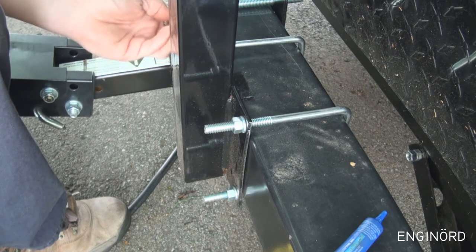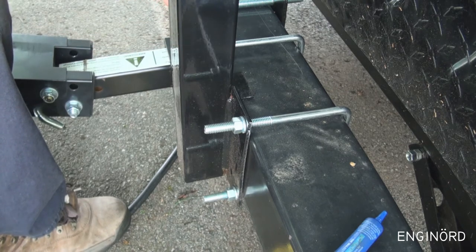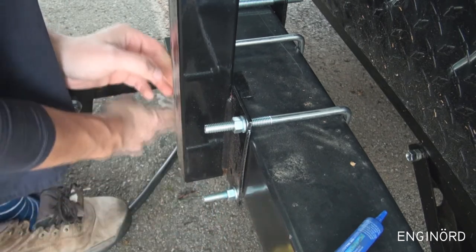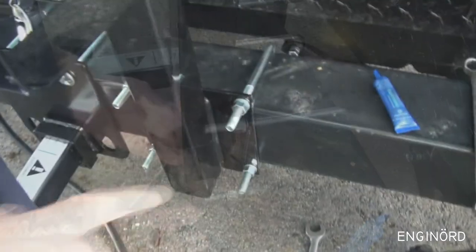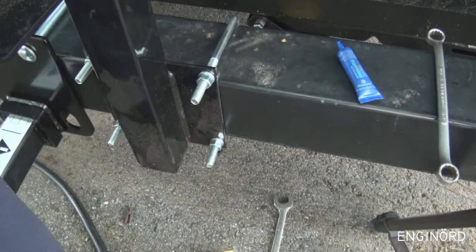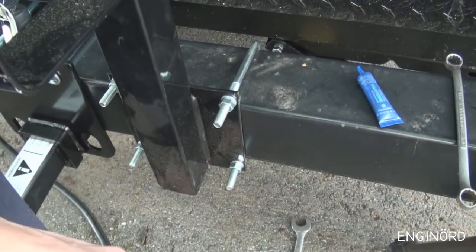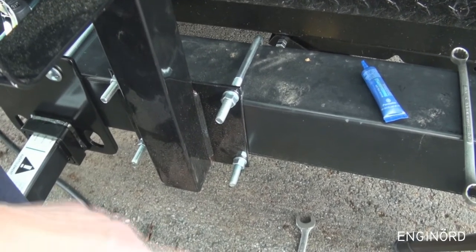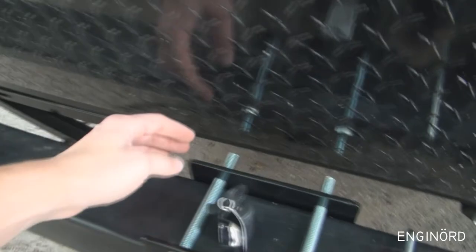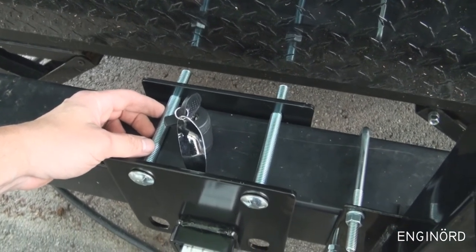All these RVs are manufactured from cheap parts and unfortunately they break. But if you have some spare parts available you can do a repair on the road. You can see I tightened up the nuts and this flange started to bend back a little bit — there's a solid clamp with the paint acting as a hard-coated plastic layer in between. Just watch these nuts; if you assemble something like this make sure they're not backing out. Re-tighten them after one or two trips and make sure they're not loose.